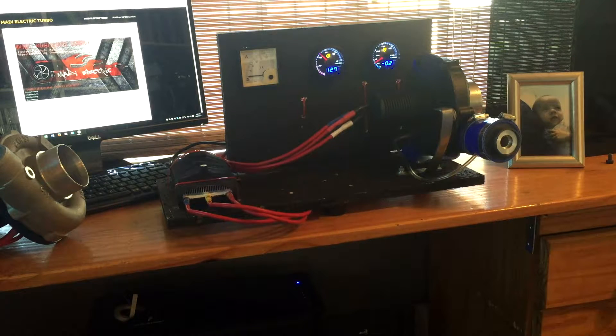We are going to push the test rig on now and then you guys can actually have a look. Please notice the boost gauge indicating a -0.2 on the gauge, and that's due to the geographical position we are at. We will try to spin the turbo up and see if we can achieve a positive 0.2, which will give you a variation of 0.4. So if you are at the coast you will probably get a full 0.4, but where we are, away from the coast and sitting quite up high, we get less performance. Let's have a look and see what happens.